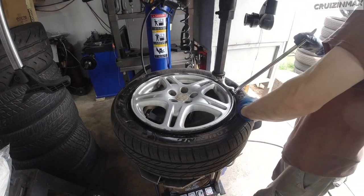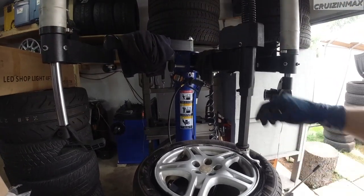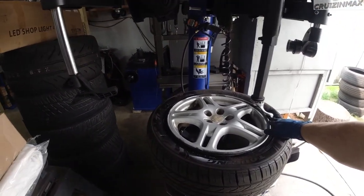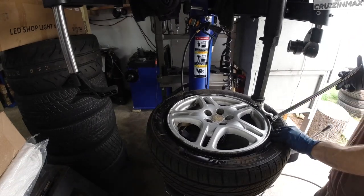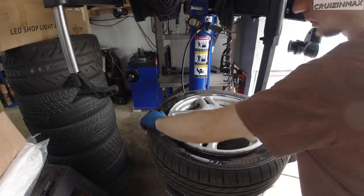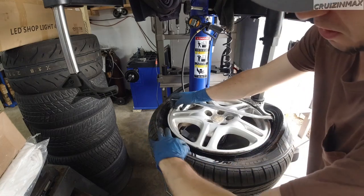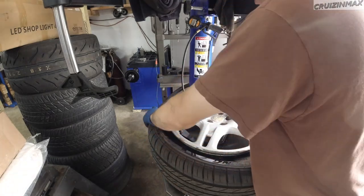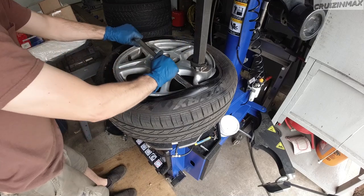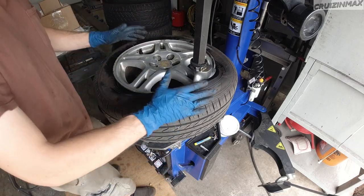Take this tool, shove it up. I forgot to lock it — it moved on me. So this is where you lock it, so it keeps this away. Now it won't move much — this is a cheap machine. As I swing this over I'm going to push in here on the other side of the tire, so the bead of the tire will go down. Now I got to move you again. We have that going, holding this, pushing it. I'm going to start it. I don't need this arm anymore — this is going to be an easy tire. I'm going to keep spinning it.